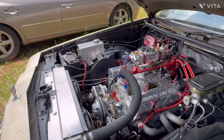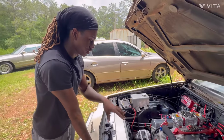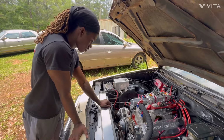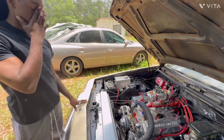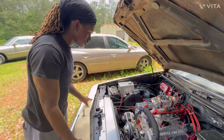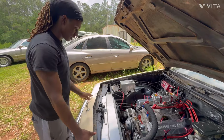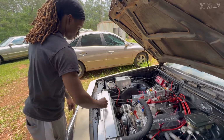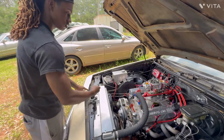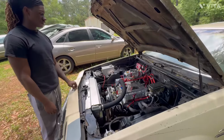Yeah. But yeah, back to what he was talking about. Take intake off, valve covers, all the front end stuff, radiator, and then grill. Yeah. Swap the cam. Well, I don't think I gotta take the grill off like that. You might not have to. With the radiator gone, you got all this space. You might be able to work with it. Yeah, I should be able to. Yeah. So yeah, that's what you got going on. That's what's up next, man.